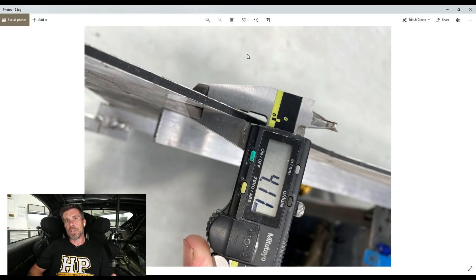The material we've used is called Aluplast — two very thin layers of aluminium sandwiched with plastic in the middle. It's not the best product because it is quite heavy. This whole contraption including the flat floor and alloy framing is somewhere in the vicinity of about 16 kg, which is about 32–35 pounds. It's 4mm thick so it is actually quite rigid, which is important — we don't want the risk of this coming loose and ending up under a tyre. So it's important to have something with a reasonable amount of rigidity.